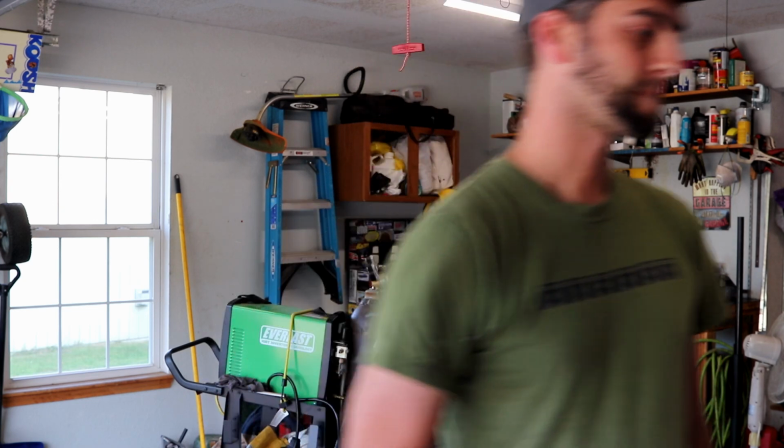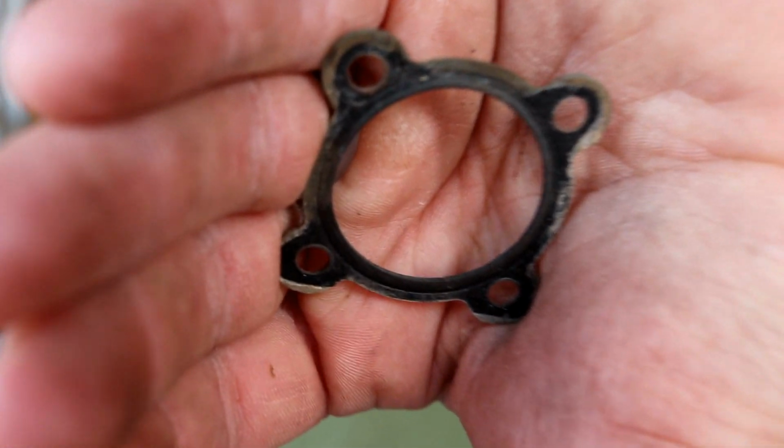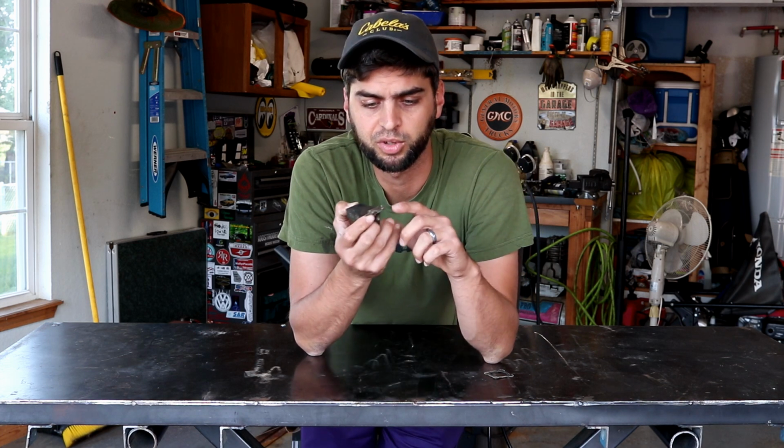That also doesn't mean that we didn't learn something along the way either. Late last week I replaced the power valve gasket because I was trying to run off of the old one in my rebuild kit, and I found the tab on the float was getting hung up on the gasket of the top cover, so I shaved a little bit off of that top tab, and that seemed to fix those problems. As I operated the accelerator pump arm, I would see fuel shooting into the venturis, so I knew we had fuel. We knew then it had to be a spark issue.